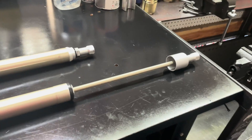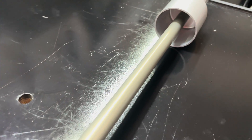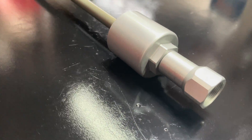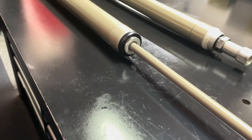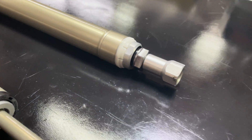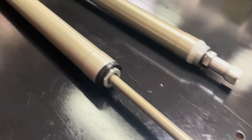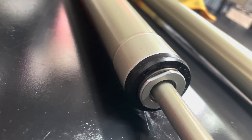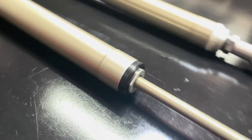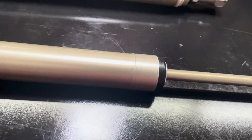When WP added this bottoming cone onto the cartridge damping rod, they also used a ton of Loctite and heavy torque to ensure that this bottoming cup never comes loose. While this can be removed with proper tooling and lots of heat, it is also going to leave a lot of Loctite on the threads and will surely damage the seal if we were trying to remove the cartridge rod through the seal head like we do on the previous version. So instead we're going to leave this assembly together, remove the snap ring, remove this black piece, and that allows us to get to these two flat faces, and we will unthread what we call the cartridge cylinder head from the cartridge cylinder.